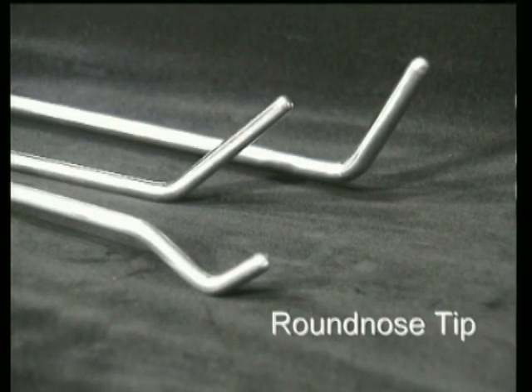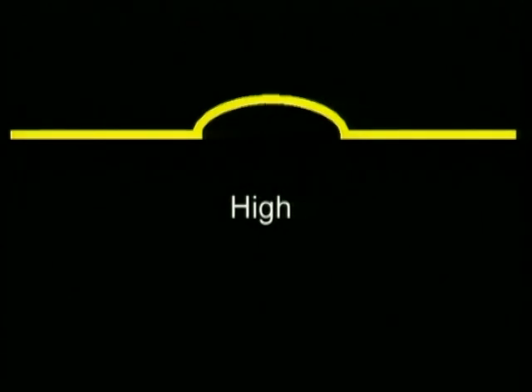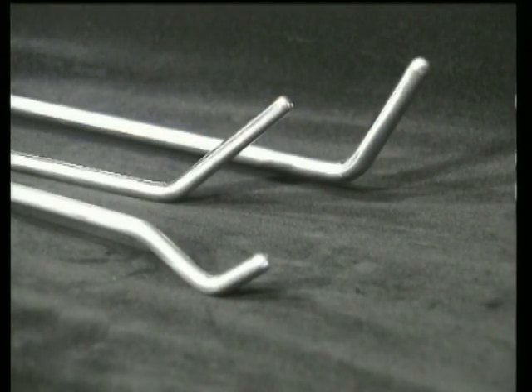This tip is a good all-round tool. It is softer than the other tools and will allow the use of more force. Many people feel that it is easier to control than the cutter and taper tips. It is particularly good for light damage and minor dents. With a round nose tip you must take care not to produce a high — in other words, a dent that sticks up rather than down. Although not a severe problem, creating a high will add to the time it takes to effect a repair. As the round nose tips are smooth, care is needed to prevent slippage, which can cause a high away from the damaged area.